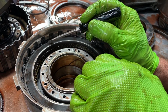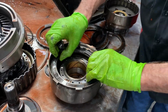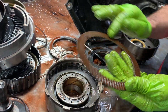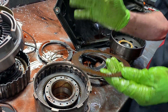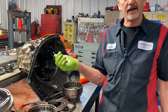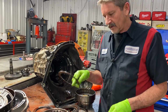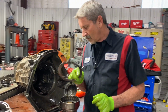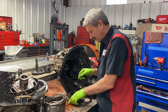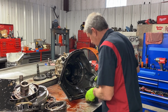Now what I might do, since I don't like that, I'll go and grab me another 3rd gear clutch, and I'll get 2 of them, and I'll shave the backing off one side. Off the other side, I'll put them together. Now they're locked together. Put them back in there. Now my clearance is back up where I need it to be. So there's multiple ways to get your clearances, but you really want to get that extra clutch in there because just that one clutch makes a big difference, guys, when you're towing heavy weight. So write that down. That's a really simple upgrade.